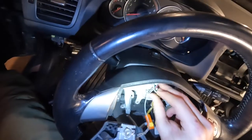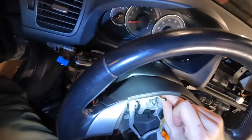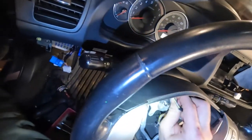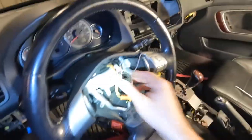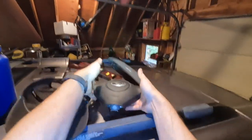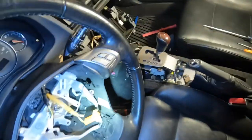This clip slides off the bottom here, and this white one you're going to want to take off as well — you'll see why later. Put the airbag out with the white pigtail that's connected. Store it in a safe place where it's not going to go anywhere, airbag side up. Now we're going to grab our 17mm socket.